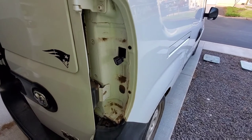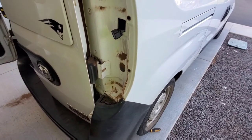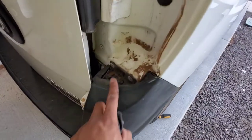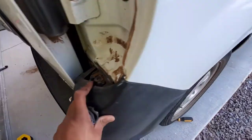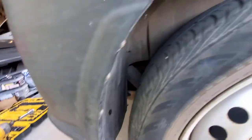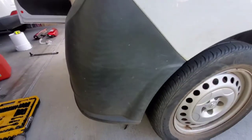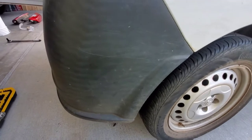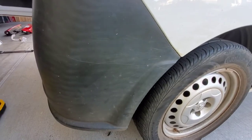Now that the lights are off we can get to a bunch of these screws that are holding the bumper to the frame. We got one T27 right here, a bunch of screws — one, two, three, four here — and one right down there, and it's pretty much the same on the other side. Let's get these screws off and keep going forward.